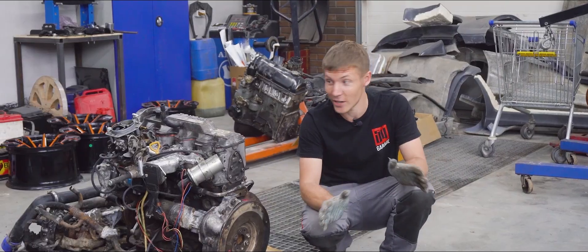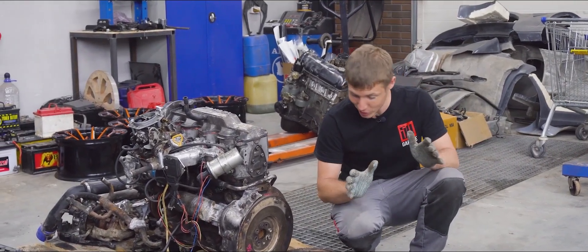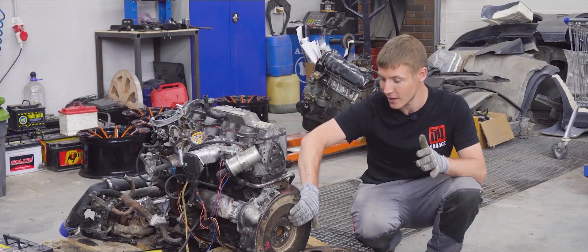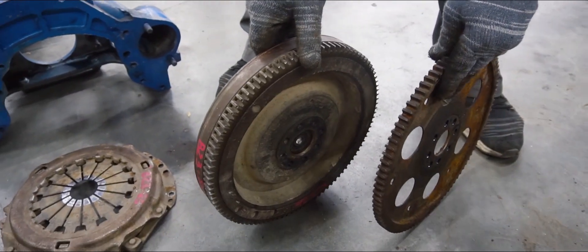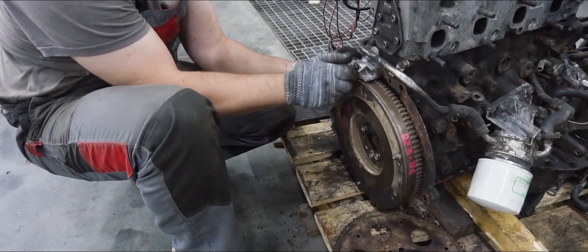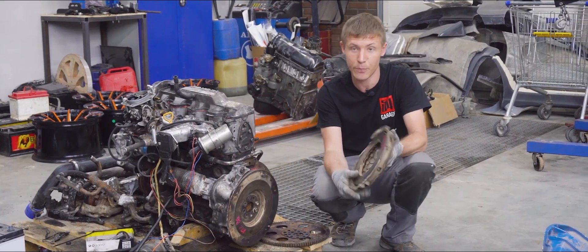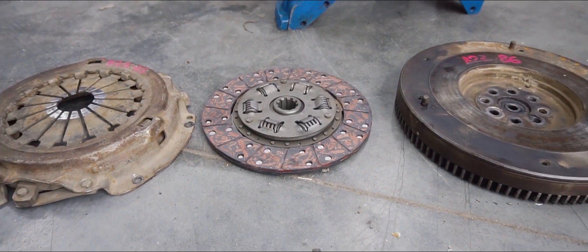In the meantime, we've put together a complete swap kit — like all the ingredients. Let's take this from the top. We've already installed a gigantic flywheel — the stock one that came with the 2C engine. It was inexpensive and obviously a perfect fit, though the factory bolts are not ideal given how thick it is. Then we have a clutch pressure plate for this specific flywheel, the one you'd find on this particular diesel.